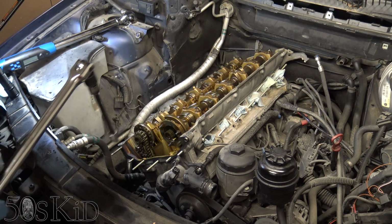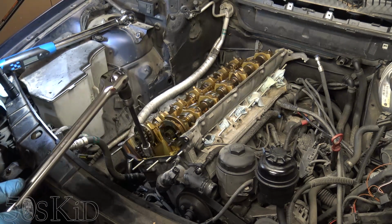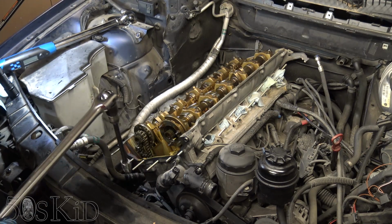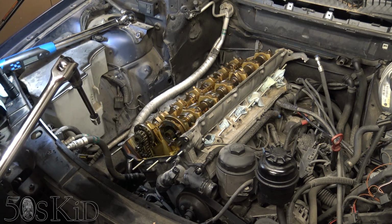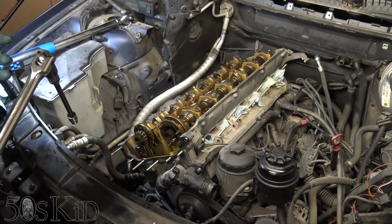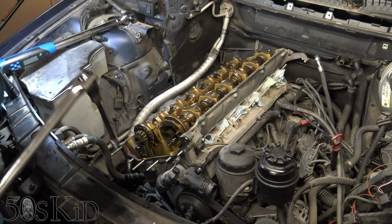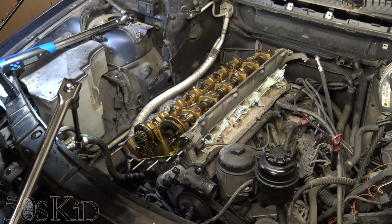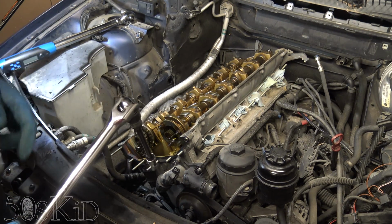recheck the torque. The torque procedure is usually 40 Newton meters, then another 90 degrees, then another 90 degrees. And that is the proper way to do it. But the final torque ends up being something around 60 foot-pounds, you know? So I think if we recheck to 60, that's going to be enough to tell us if we're still good, or if the threads have pulled out.